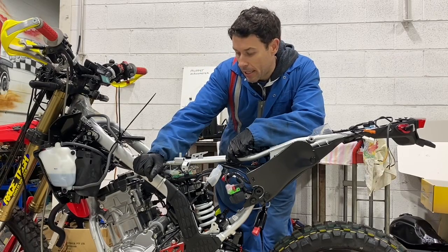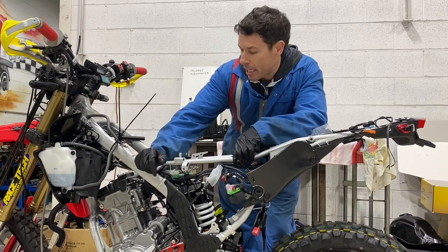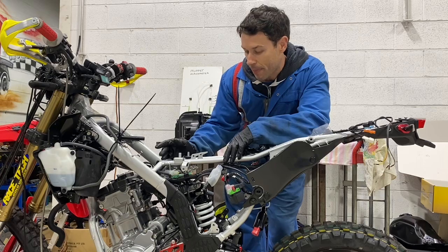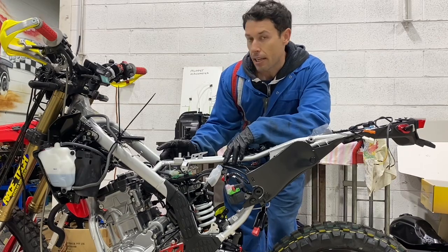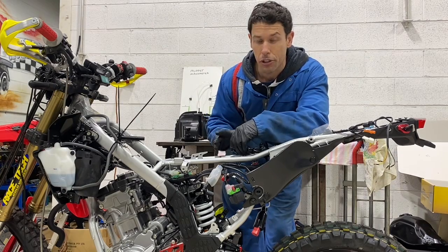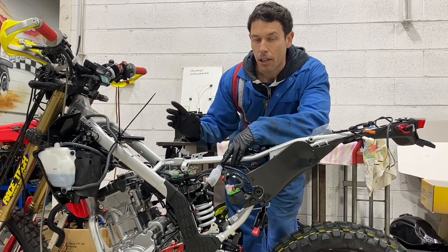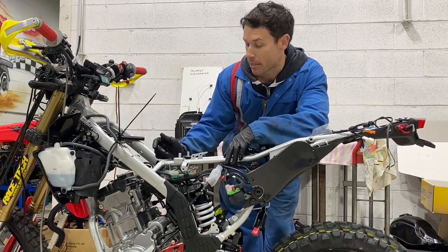Welcome back, everyone. In this video, we're going to debunk a few things people are saying about the airbox system on these bikes. The airbox and air filter design on this bike is said to be very restrictive. What we've come up with is a manometer test. We're going to test the restrictions through a standard airbox, all the different configurations of a standard airbox, and also a fully modified airbox with a CB300 intake. It's going to have several different types of air filter systems.